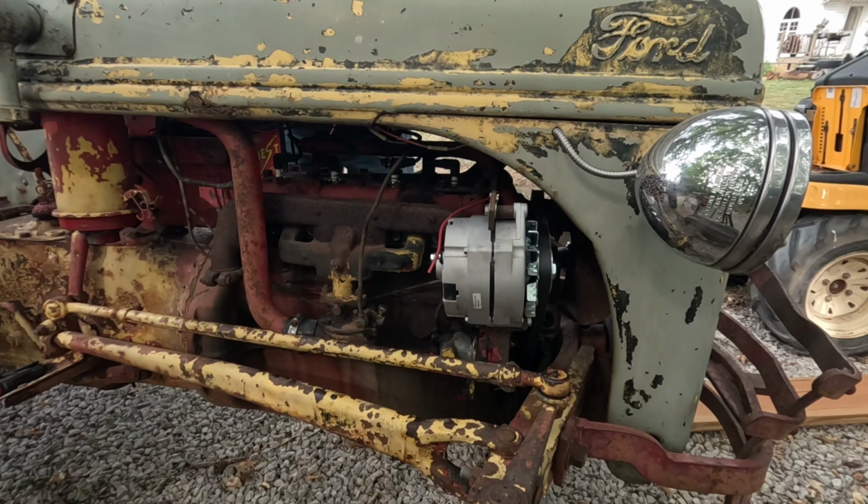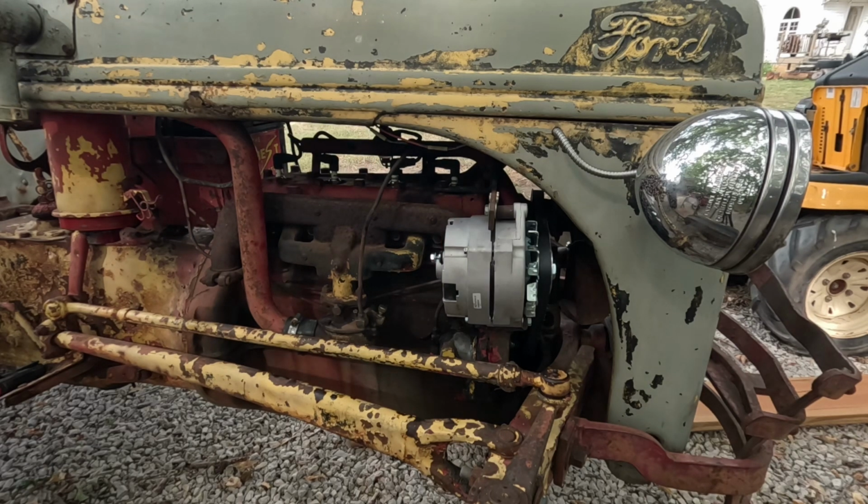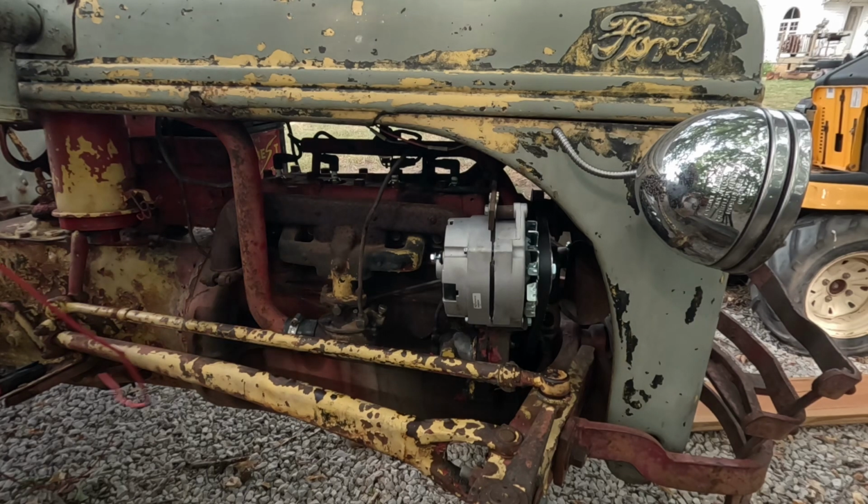I'm actually running it over, and I couldn't get the wires loose on the back of the old amp gauge. So for now, we're just going to run it straight to the battery, but leave the wire needed to get it where I want it on the starter. And I'm going to cut it just a little bit long.